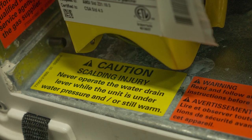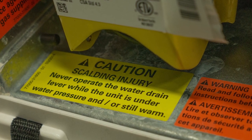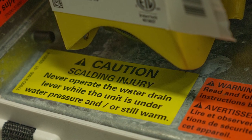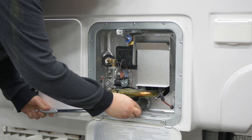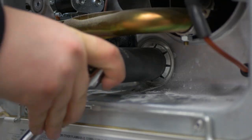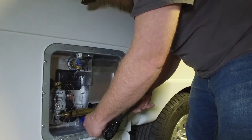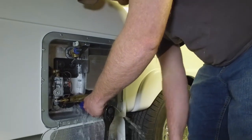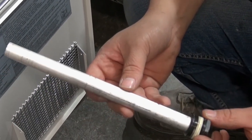Next, you will need to drain your water heater. During this process, please be extremely cautious as some residual hot water may still be in the water heater tank. Failure to do so may result in a scalding injury. If you are indoors, place a large bucket below the water heater door before beginning the next step so you can catch the water as it drains. If your unit is equipped with a Suburban water heater, use an inch and sixteenth socket to remove the anode from the bottom of the water heater and leave it uninstalled while the water system is winterized.